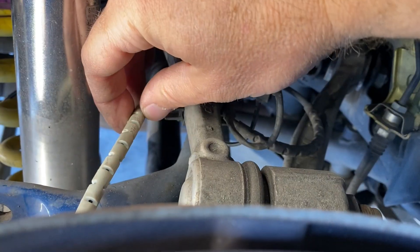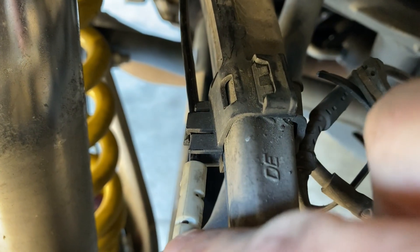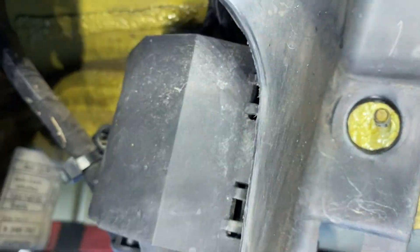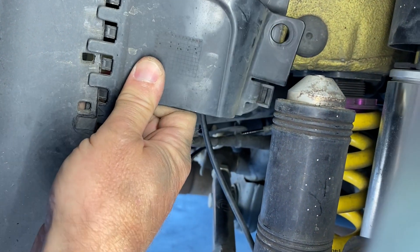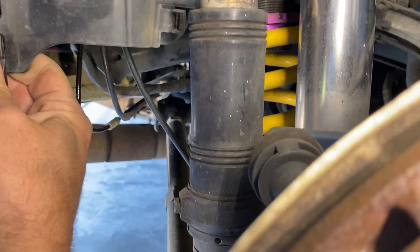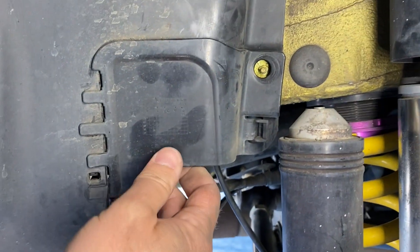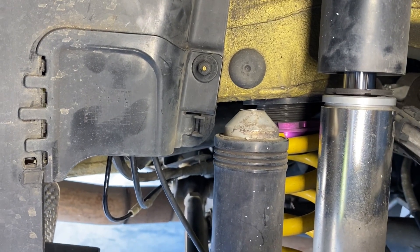You'll see a little white plastic piece — there's a little tab you can just lift up and pull the bottom piece out. Right behind the spring is another one — same way, gently lift that off and detach it. There's a little clip on the side, knock that loose. Back from the top, detach it at this last point. The bolt is held on by a T27. Take the sensor back out that we had cleaned off and yank it out.